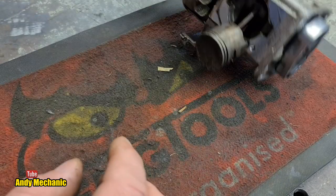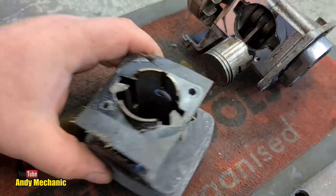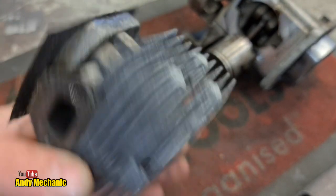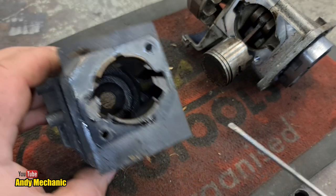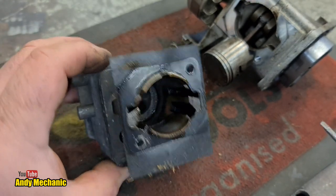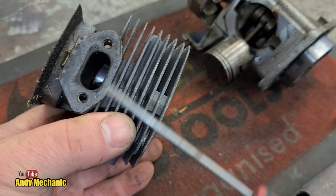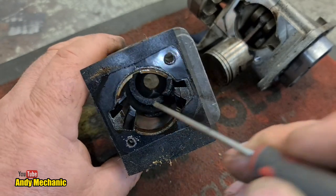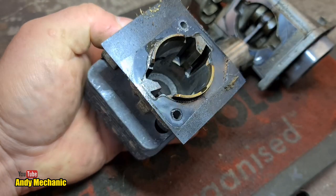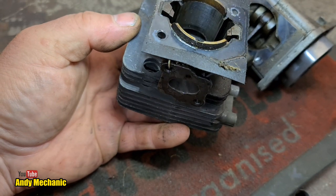Let's have a look at the cylinder. Notice on this that the cylinder head — the end of the cylinder — is all one piece; there is no head gasket as such, just one complete casting that's been machined out. That makes it really cheap to make, fewer components, and no head gasket to fail. Quite clever really. On small engines they can do that. What's the bore like — is the bore all scored? You can see the ports where the mixture enters the cylinder. There are the transfer ports up the sides.